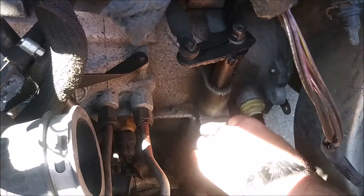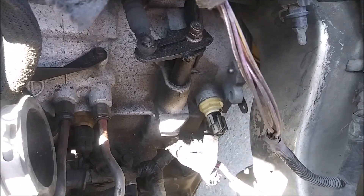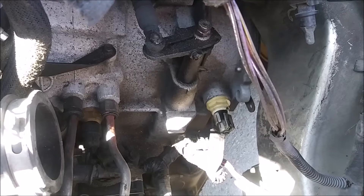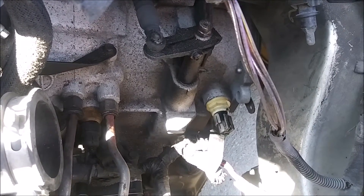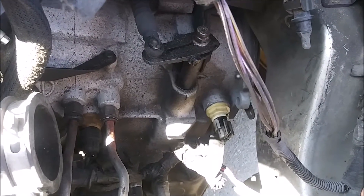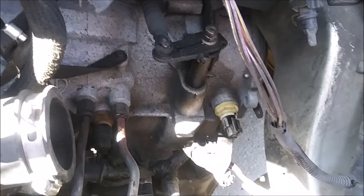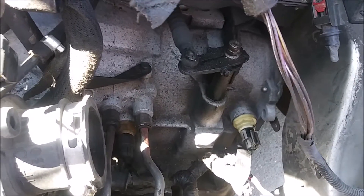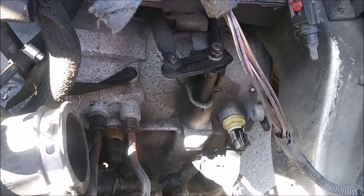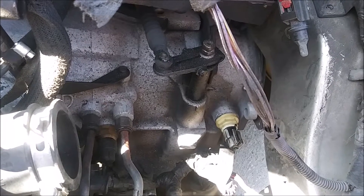That's tight enough. Output speed sensor has been replaced — vehicle should now drive. If you want to know the symptoms of a bad output speed sensor: the car goes into limp mode, you can't go over 20 miles an hour, and your speedometer reads incorrectly — it starts jittering. You don't have much warning; once it starts doing that you better be on your way to the parts store. You have about one or two days of jitters, then it'll pop the code, and once the code pops you have less than a day to get somewhere. That's how we replace the output speed sensor on a 2005 Dodge Neon — hopefully this helps. Thanks for watching!